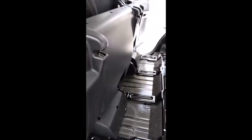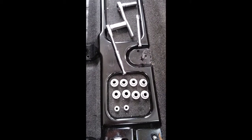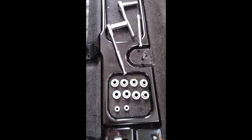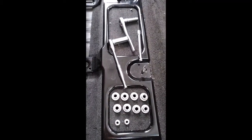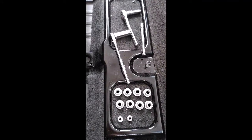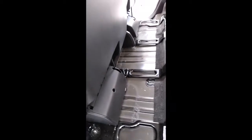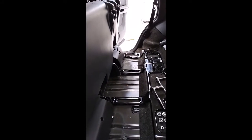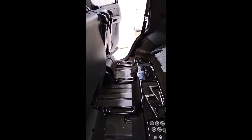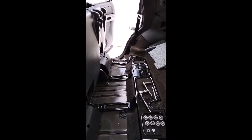So I'm at the point where I took off all of the nuts. And so as you can see here, there's 8 of the number 18 nuts, 2 of the number 13. So I used deep well sockets for both and an extension for the 18 that's in between the two seats on the split bench. So what I'm going to do now is take the seat from its upright position and put it back down in its normal position, and I believe I'll be able to easily extract that. But of course I can't film this and do it at the same time, so I apologize. So I'll update you on my progress with the next video.